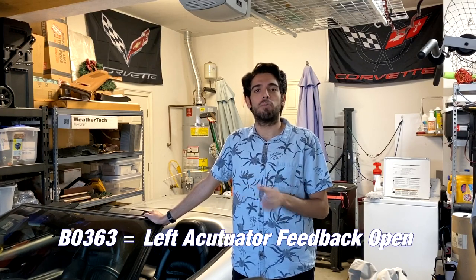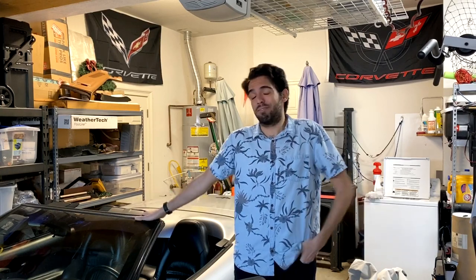After running the diagnostics on my car, I got error code B0363, which signals an open circuit for the actuator. It turns out that's probably due to the door that the actuator operates not fully closing or opening, giving an improper signal to all the circuitry involved in operating the HVAC system. This gives it an error code and prevents the AC from functioning because it thinks there's an error and just shuts it down. My actuator still functions and can still direct airflow properly, but because it's not giving the right signal, it's causing a bigger problem than it should.